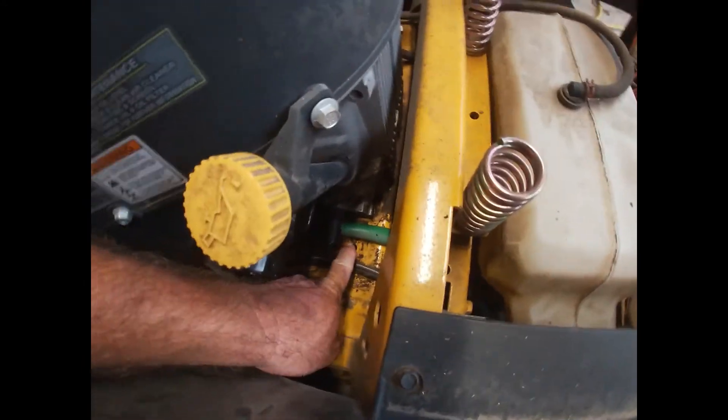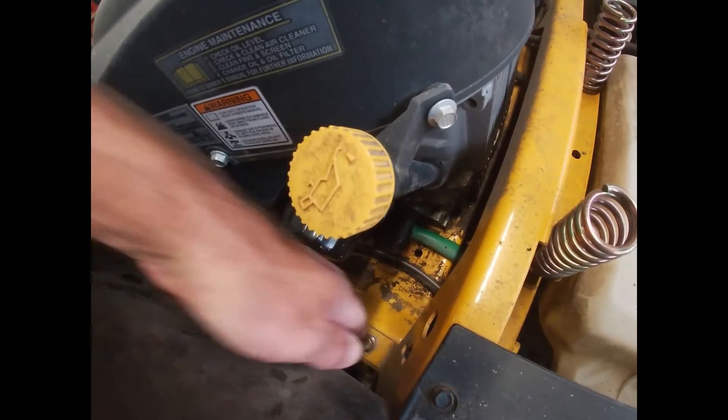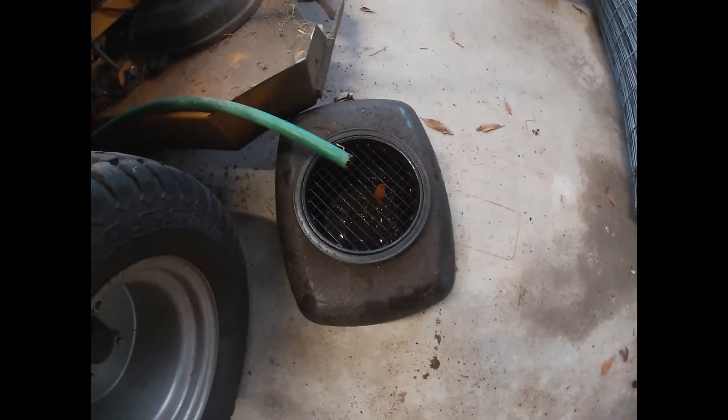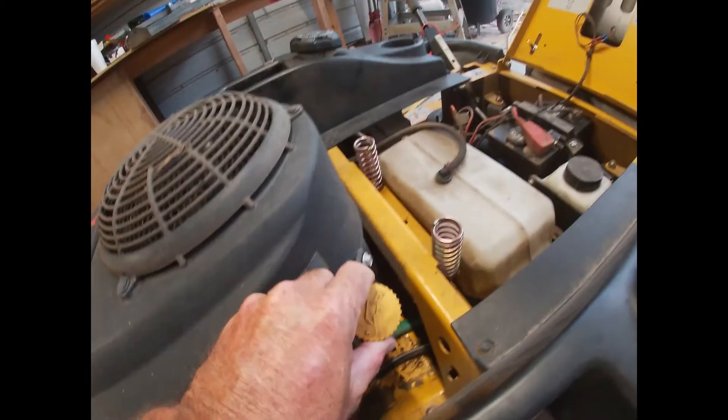They come with a little black drain hose and the hose is not very long. What happens is you have to have a very shallow pan to put under the mower if you're going to let it sit level to drain. So what I've done — I got a half inch garden hose, which is a little bit big on it, but it really doesn't have any pressure. You can see this little green hose down in here. I just cut a hose long enough — probably two and a half feet — and I've got it run all the way outside and into my drain pan.